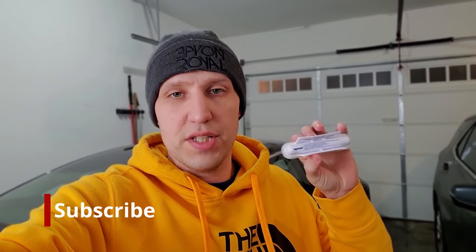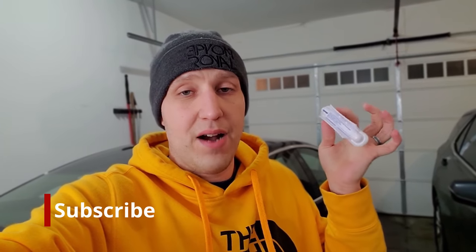I'm going to be using this, which is Aquapel. As of right now I have no recommendation because I haven't used it yet, but it has really good reviews on Amazon and other websites. I'm not going to use it on the windshield because people complain of chatter with the windshield wipers getting stuck, but I'm going to put it on all the cameras. Then on the front I'm going to use NeverWet Step 2, which Tesla shows on their website. It doesn't say it has any curing time, but I figure I'll do it now so it'll sit overnight and it'll be about 48 hours before I encounter any snow.